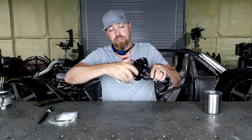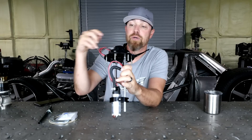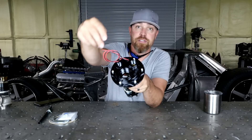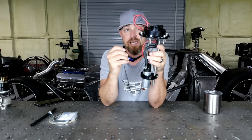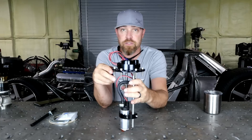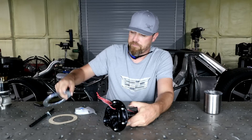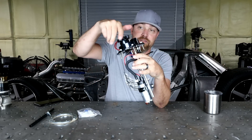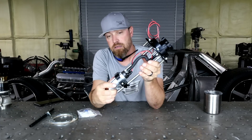Now this particular unit here has a filler on the top. It's got this billet top to it — you got a filler, you have a fuel out and a fuel return. So your fuel comes out, goes through your system, and returns back into here. This thing comes with a tube that basically puts that fuel back in the tank. It's got your power wires sealed up in here. You just drop this in a fuel cell or fuel tank, bolt it up. It actually comes with a gasket, a trim ring that goes underneath it, and a filter that goes on the bottom. So really it's everything you need to convert something to EFI or to just convert a fuel cell into this style EFI pump.